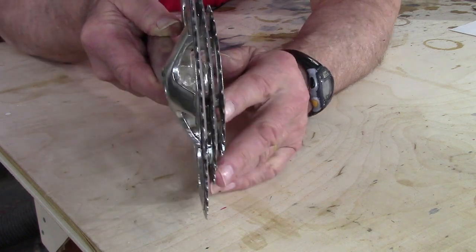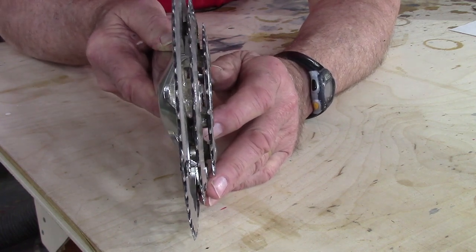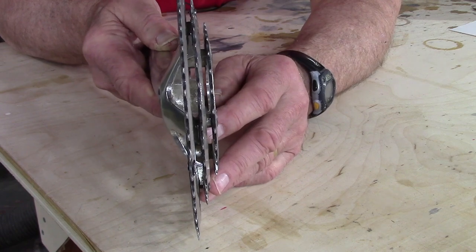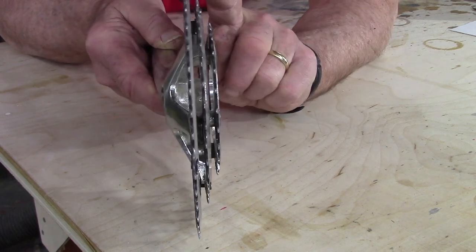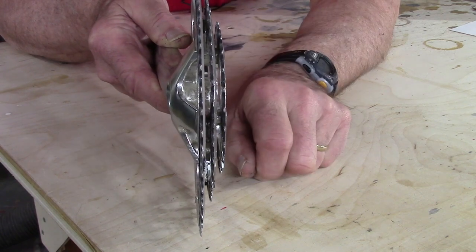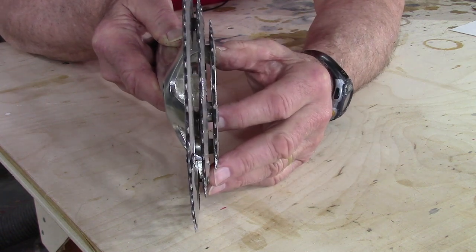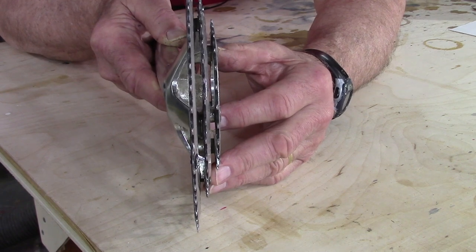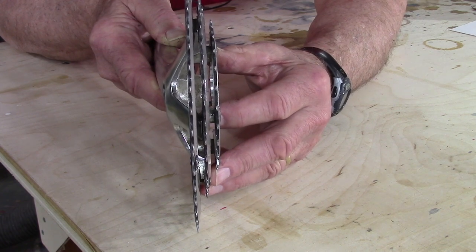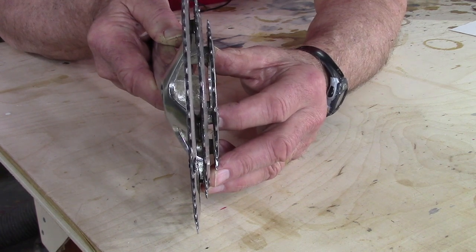The other important thing is to maintain the chain line of your bicycle. The bicycle is designed with a certain chain line, and the operation of your rear derailleur, front derailleur, and cassette are dependent on it. The definition of chain line is the distance between the center of your frame and — for a triple — the center of the middle chainring. The definition changes depending on whether it's a triple, double, or single crankset. I've posted a link in the description to a very good article by Park Tool that describes chain line in more detail.